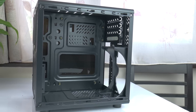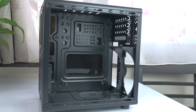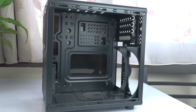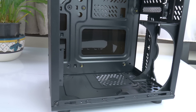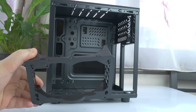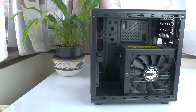The PowerCube 715B can accommodate both micro ATX and mini ITX sized motherboards with a reverse mount, so everything's going to be upside down. This is where the compromises start coming in. To keep things compact, they had virtually one option for the PSU location. So your standard sized PSU — no need for small form factor ones — gets fixed into this plastic bracket and is then inserted into the case, upon which it completely blocks your entire build.